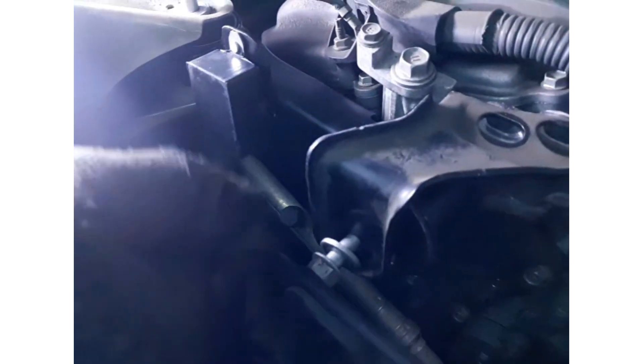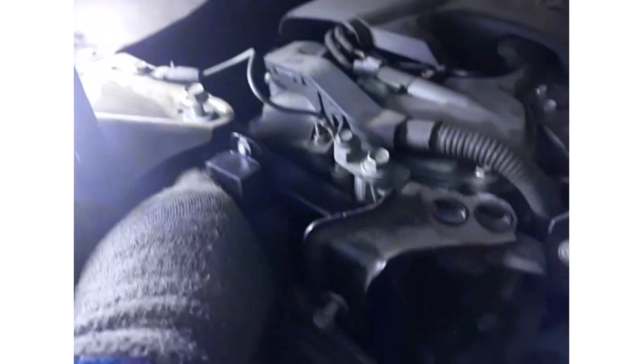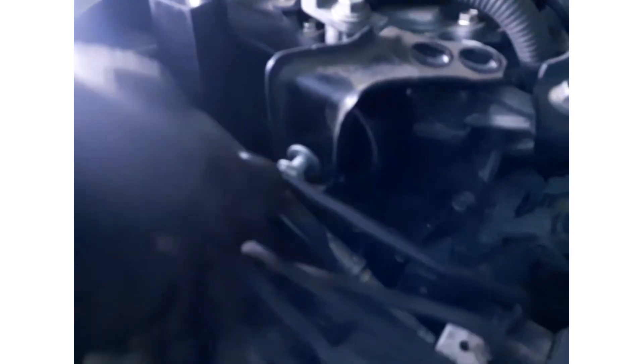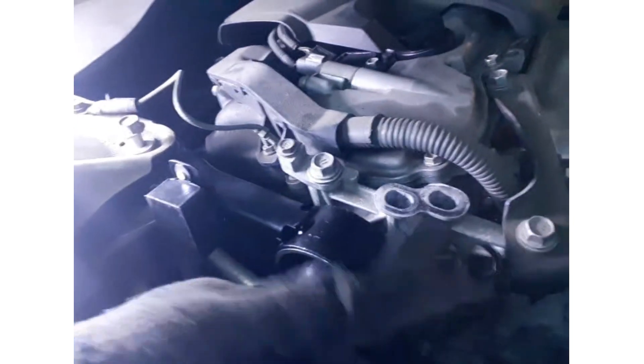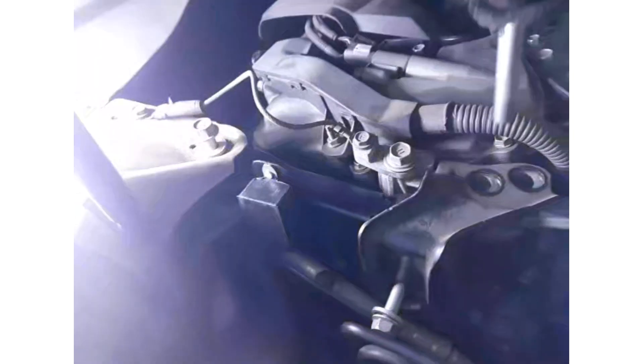To follow the right sequence, I have to take this out, then put the bolt with the plate right through the bushing of the motor mount, slide it in, then slide this back in, and put the bolt in there to anchor it. I have to do it like that because I don't want to damage these hoses or linings. Just to give you an FYI — when you're working on this, make sure you exercise extreme care. You're trying to solve a problem, not create another one. Make sure you follow the procedure as it ought to be.